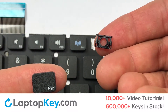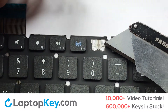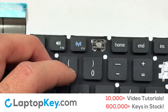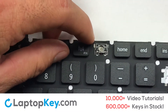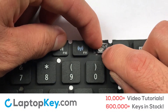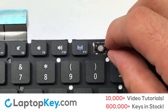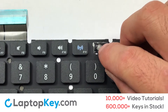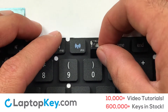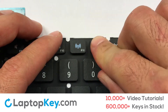We're now going to install the small key. Gently align the retainer clips so that they catch the metal hooks on the keyboard. Apply pressure to the lower tabs so that the key retainer catches onto the metal hooks. Place the rubber cup in the center. Place your keyboard key on top of the retainer clips. Press down to attach the key.